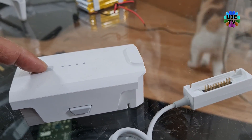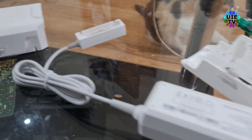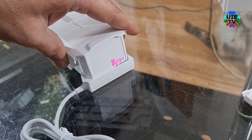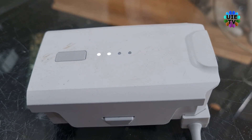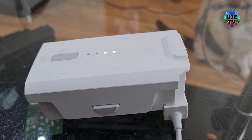To test the faulty battery, please press the button. You will see the battery has just one light blinking, which indicates low battery. Now if you connect a charger, you will see two lights blink together, then the other two, and then all the lights go off. This means the battery is faulty and not chargeable.